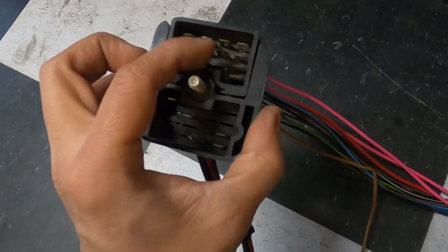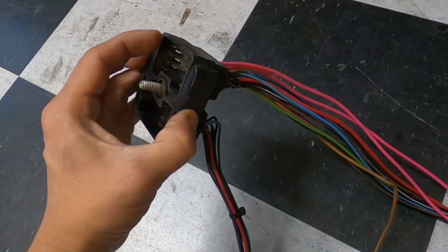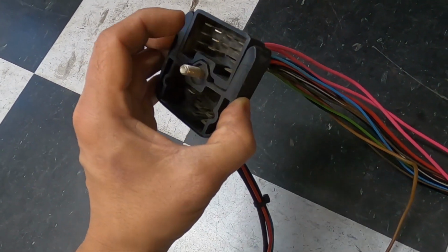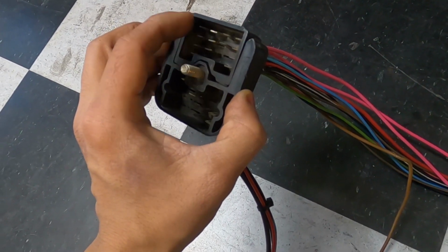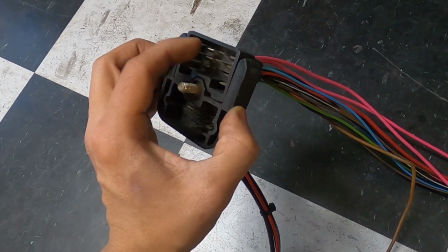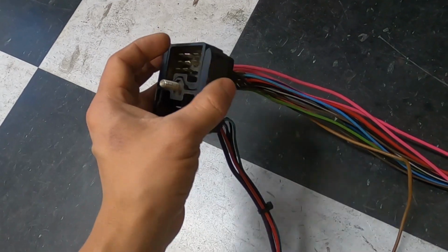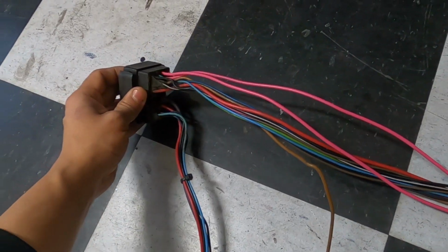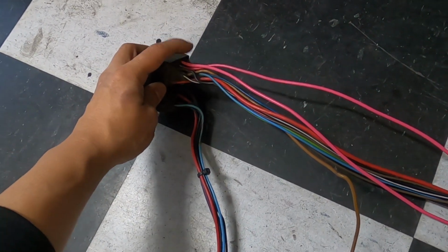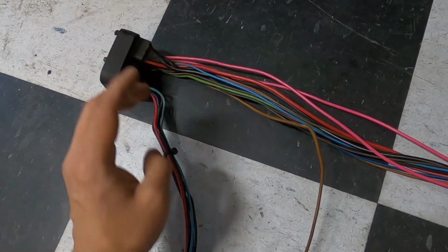But on this back side, you're going to have to match it on the other bulkhead connector on the actual dash side. So be wary of that, guys. If you guys are doing this and adding pins, make sure you add them on the other side as well. Make sure you got an ignition hot on the back side feeding that thing, or make sure it's the proper wire feeding it, not a ground or something crazy. But so we added those two there, right?